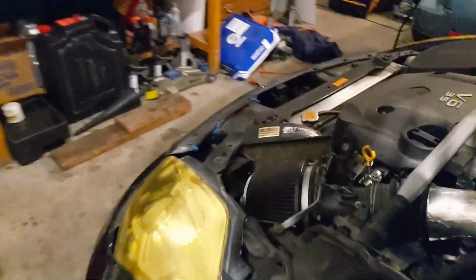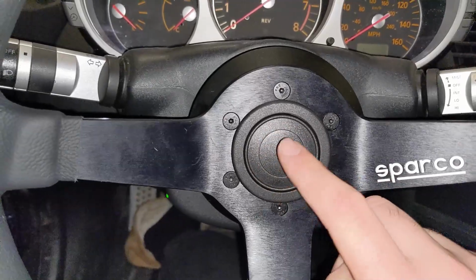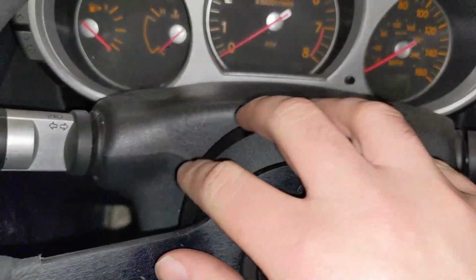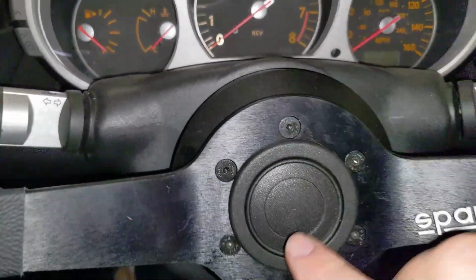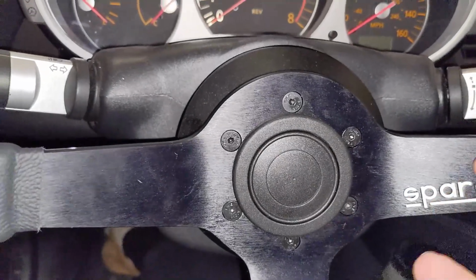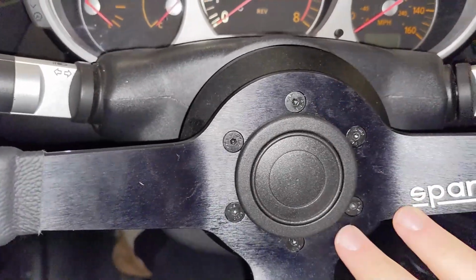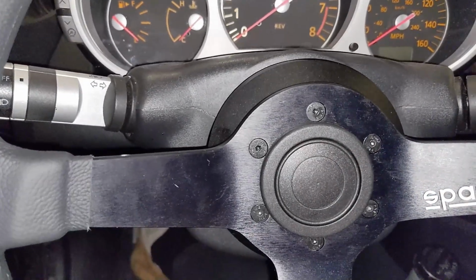I like that better. So my guess is that little plastic, that little clip, that bronze-looking clip, isn't making good contact here. Or this is painted. I noticed this was painted on the inside. There are some unpainted surfaces on the inside, but my guess is that that's on a painted surface right now, so it can't actually make a conductive path. So I could go back there and file it out. I could go in there and maybe put one wire or something in there, right, to ground it out. But honestly, not too concerned. So we're just going to send it.